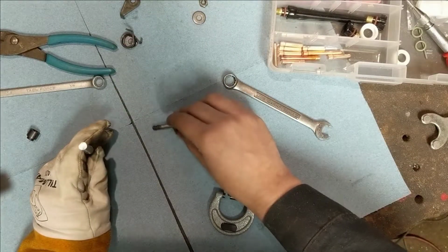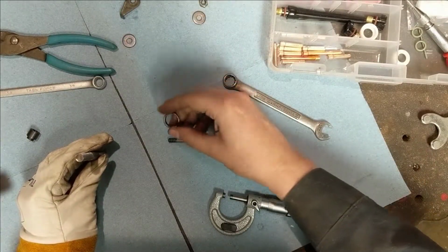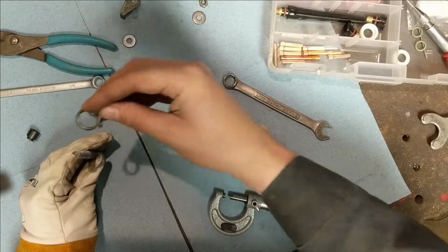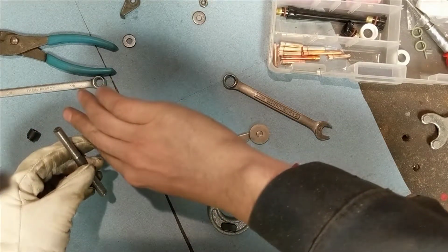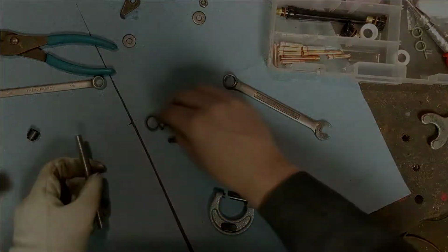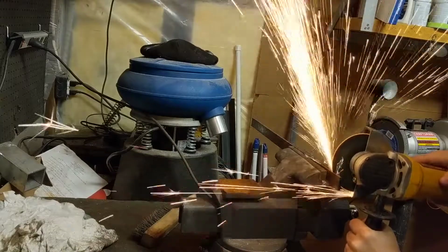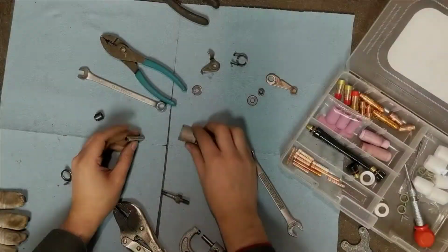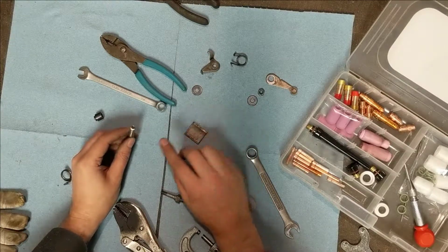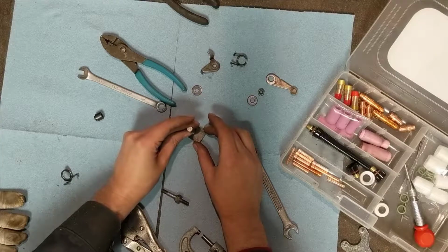But the first thing we're going to do is cut this in half and set up the arm that's going to pull this here. So we will cut this first, then weld the two pieces together to the 3/16 flat bar, and then drill this hole. Okay, cut the cross piece to length and broke the edges and ground a slight taper to the vertical piece, because what we're going to do is drill a hole here and just plug weld it from behind.